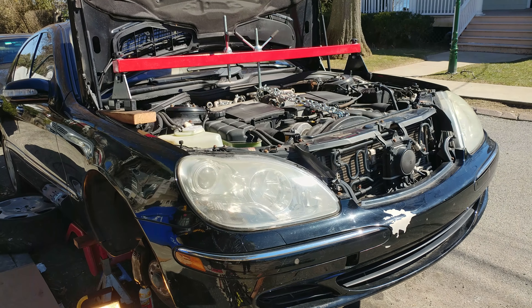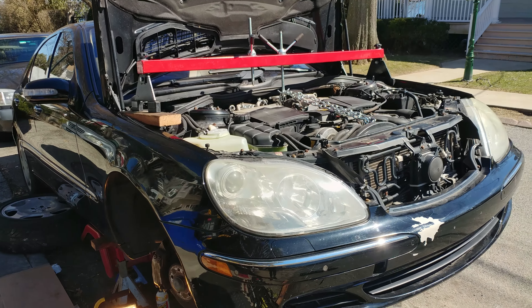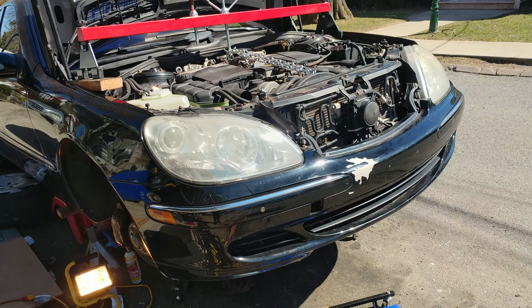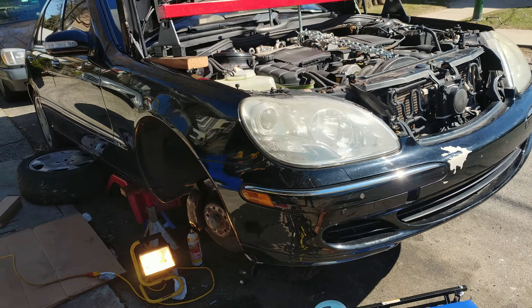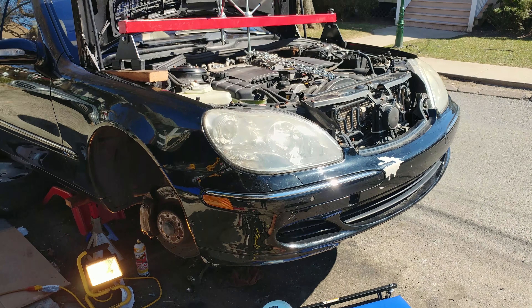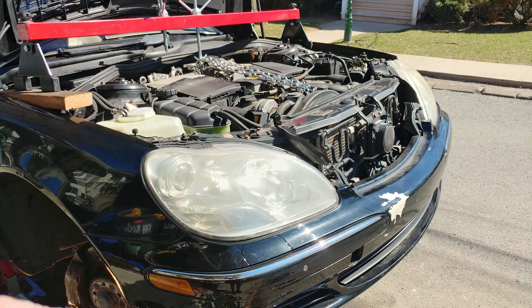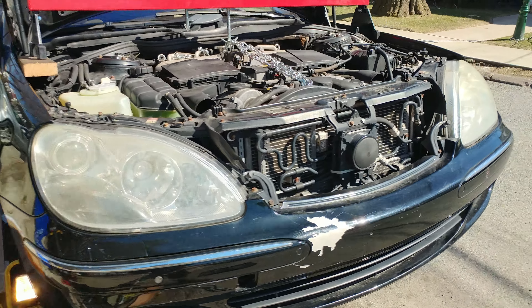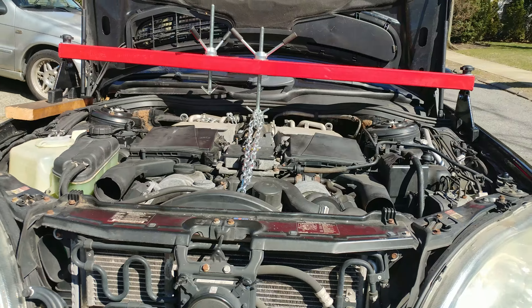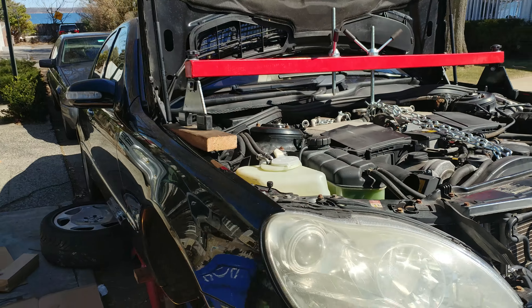So what am I doing now? It's Sunday, it's 40 degrees, I have nothing else to do — I woke up and decided to change the engine mounts. This is a V12 twin turbo, and this is actually the early style. I mentioned in previous videos that it was the latest style — no, this has to be the early style. By the book, on early style mounts you have to take the engine out.